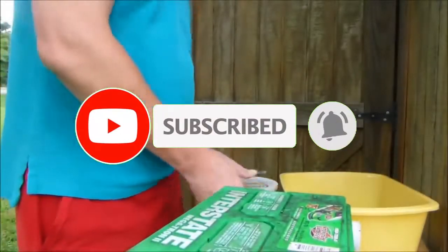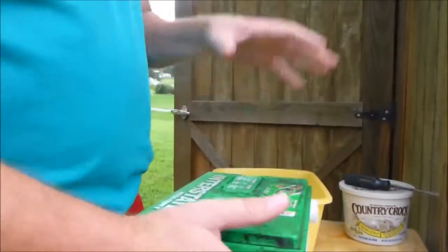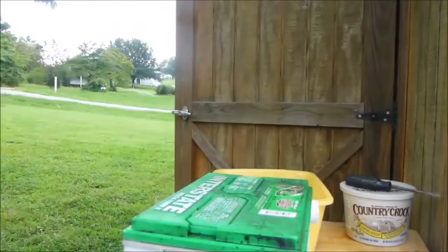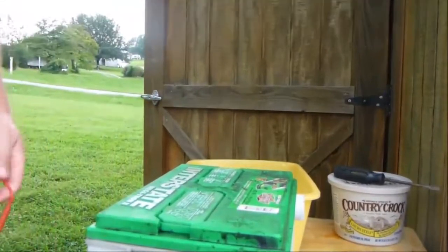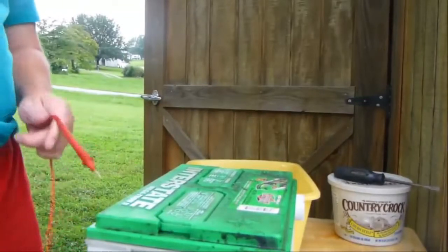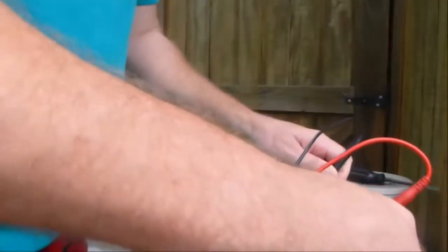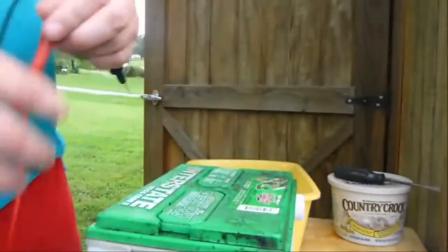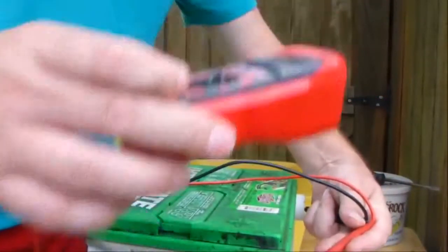What we have here is a battery that isn't really wanting to hold a charge. I put it on the tester earlier today and it showed 12.6 volts with the meter. With the truck running it was basically 14 and a half, which is what it should be. Let me check it again now — yeah, it's still showing 12.3 on the chart here.